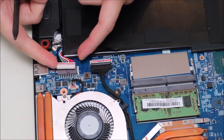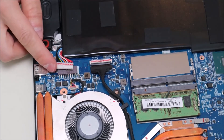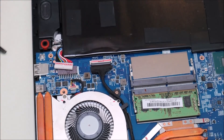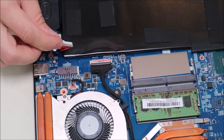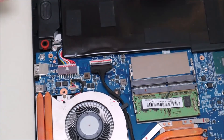That finally came out but boy was that a pain to get out — I kind of wasn't prepared for it to be that difficult. It took a lot of effort to slowly slide it back and forth, going back and forth between my fingernails and the tool to get it out. Again, avoid pulling on the wires — you're better off just taking forever to get that out. Now the battery is unplugged, and to plug it back in you would just slide it back in there. Much easier to plug in than it is to unplug.